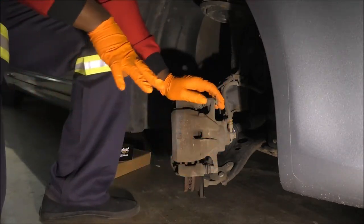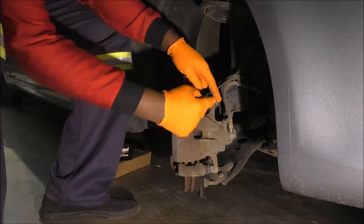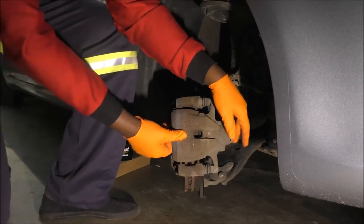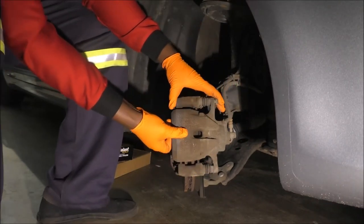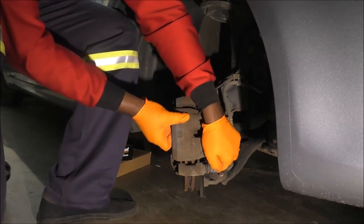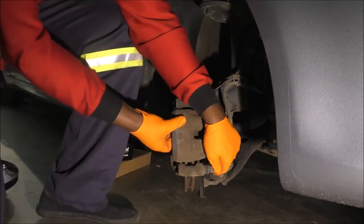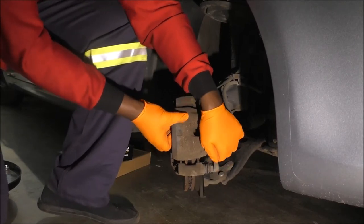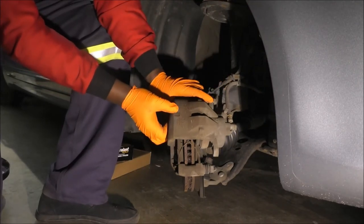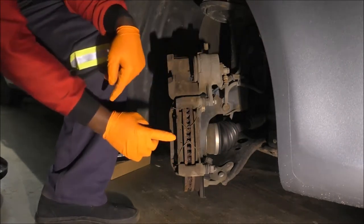If all you wanted to do was replace the brake pads, it's pretty easy. I just loosen the top and the bottom. However, the front brakes of the Avalon are pretty big, so I can't really move the caliper in and out that much, but swing it upwards. I need to punch it in, then back out. Oh, there you go. It worked to my advantage because I had done this as well, the top one. So you can just swing it up and remove your brake pads.